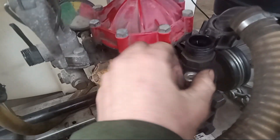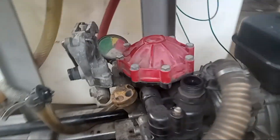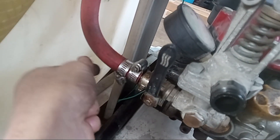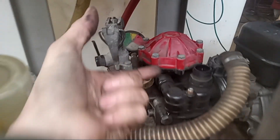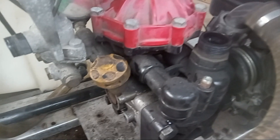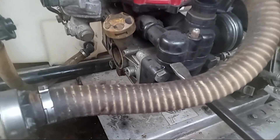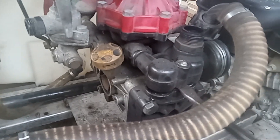You want to turn the lever and pull that off. Up here I used a 17 millimeter socket — there's a nut in the front and another one on the back side. They're already loosened up and you're going to have a hose coming around the back. You can take that off last because sometimes they're real tight to pull off. Now that the two bolts are removed, this typically slides right up, though it will feel a little tight. Get yourself a small screwdriver — remember this is plastic, so be careful — and just kind of pry up on it.